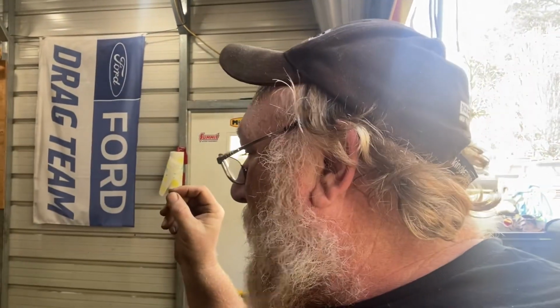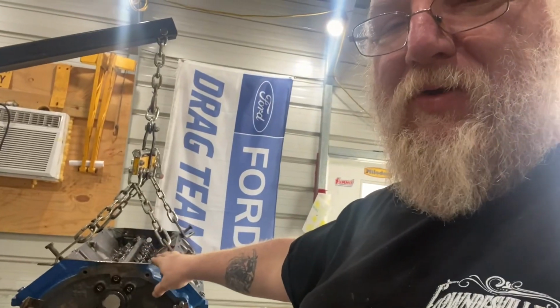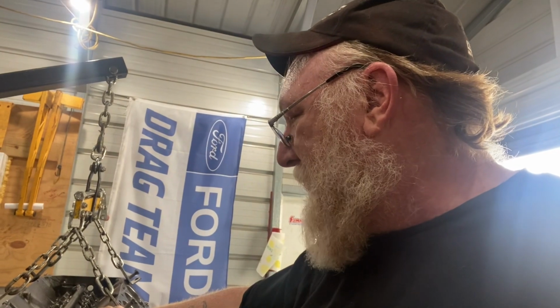And there's some differences, and I know they've got some plans with this engine. I'm trying to get the sun glare out of it. I know they've got some plans with this particular engine, and it was kind of built for those plans. So putting my short block with their top end would change a few things, because my short block has flat top pistons, it's zero decked, a little more compression, so it would change things on their end. So we're probably not going to do that. We're probably just going to rebuild this short block, go through it, figure out what happened, and rebuild it.